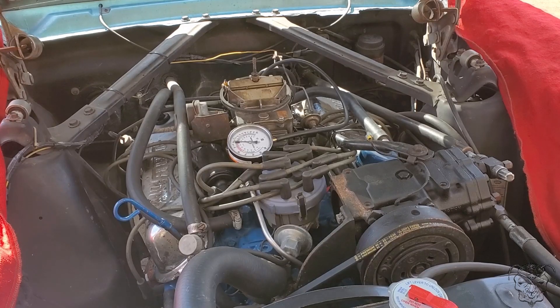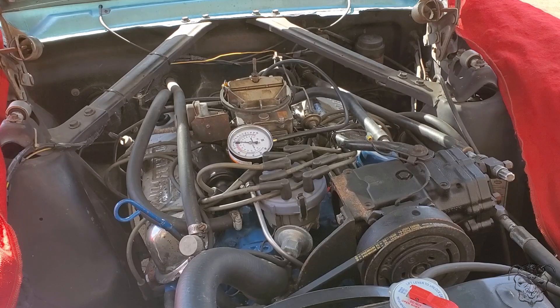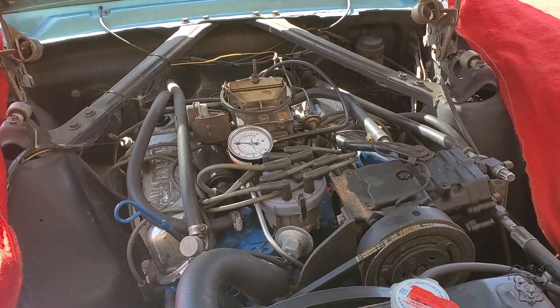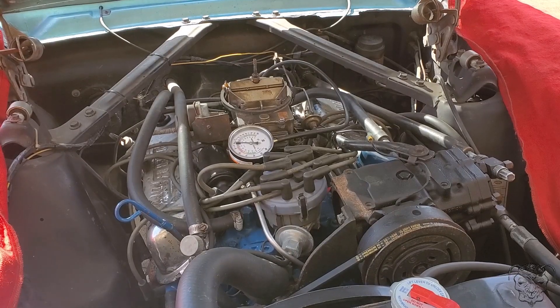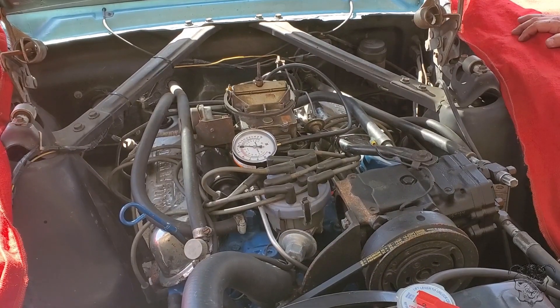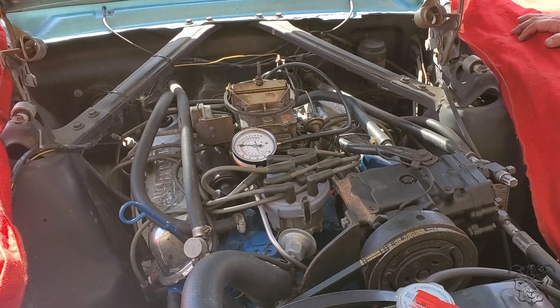All right, we got the plugs gapped and in, and I've got the vacuum gauge on it right now. It's cooled off a little bit, so we're going to test that choke again. It's like 70 degrees outside, so it's not a fair fight for a choke, but we'll do what we can. All right, Morgan, go ahead and start it. Hopefully we can adjust this out — if not, the carburetor comes off. Do you think we need to pump it or just turn it? Just turn it — I did it a couple times already, it'll probably start.